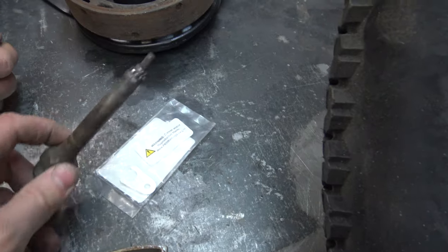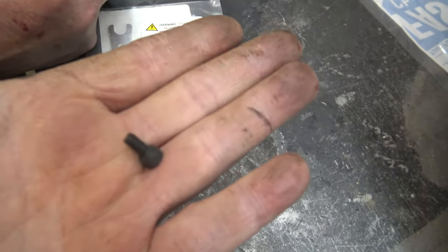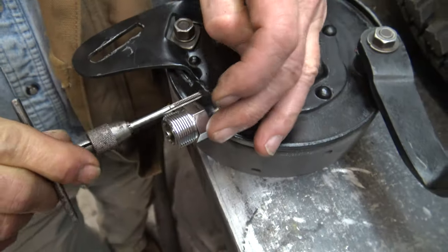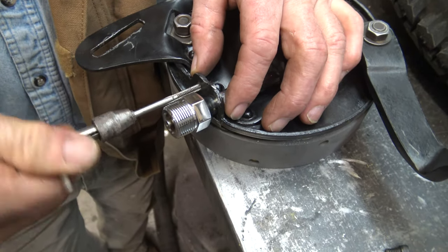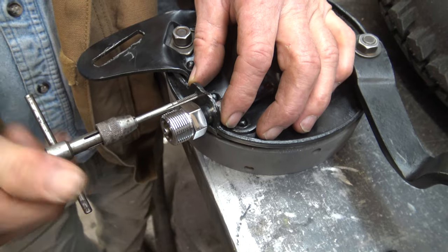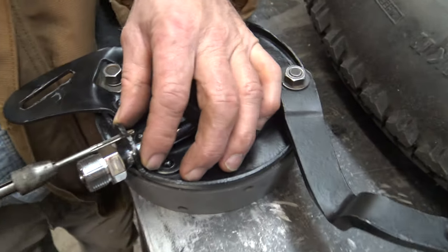I don't think we had this piece when we took it apart — maybe a piece of wire was holding it in or something. That's probably why I ground the gear off. I had to get a bolt — luckily somebody told me it's a 10-24 by 3-inch bolt. We should be able to permanently fix that. Another situation where paint got into the threads; we're just cleaning that thread up so the lock bolt will go in easy and we won't snap anything.